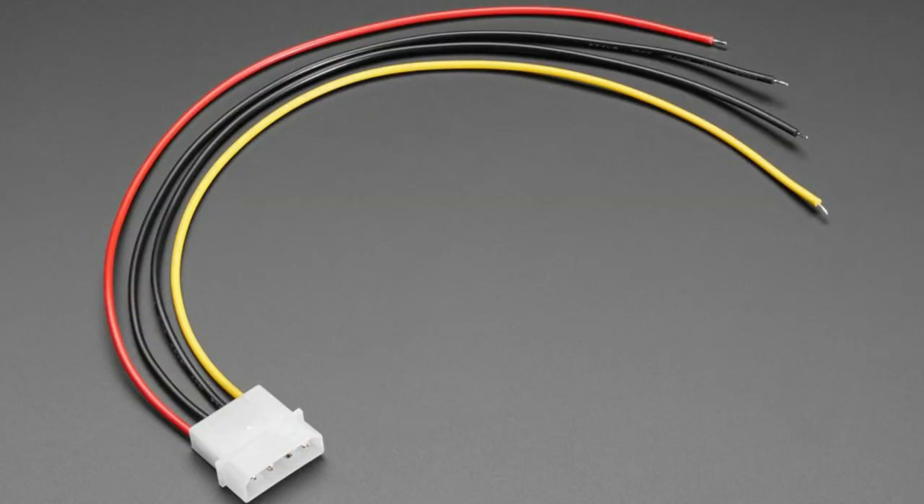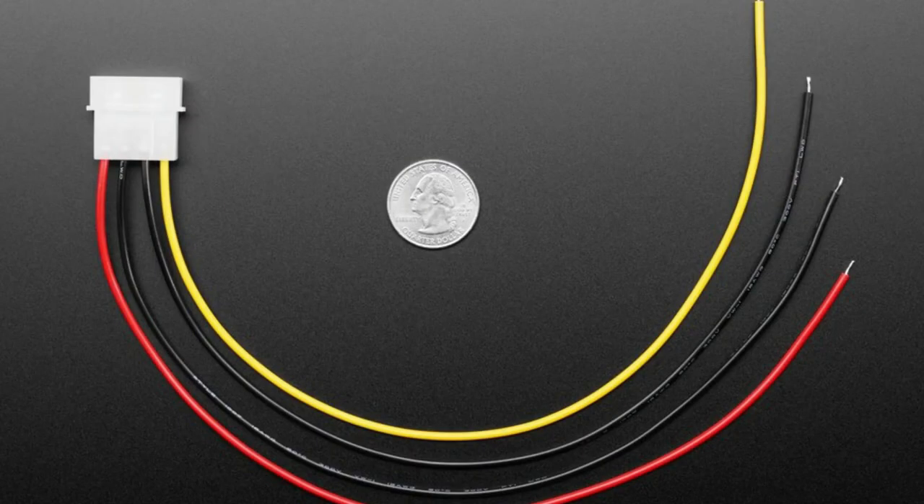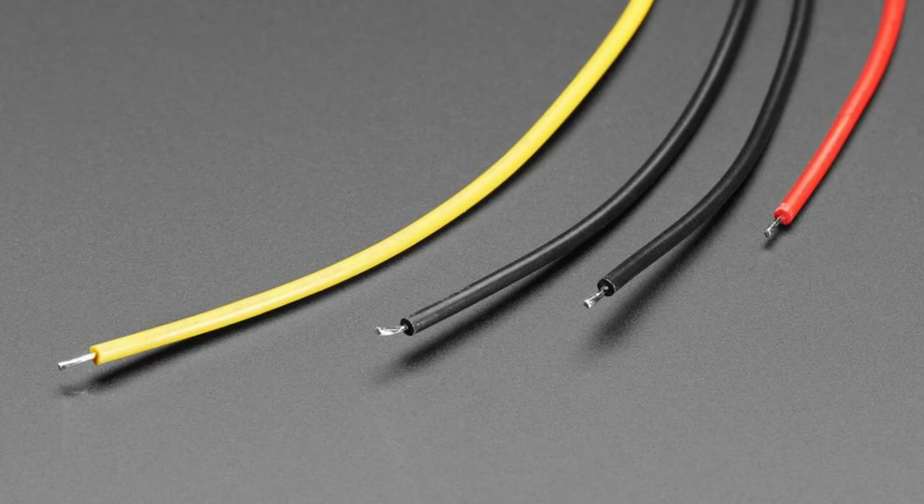Next up, another pigtail cable. This is a Molex — there's a part number, but it's just called a Molex IDE or floppy drive cable. We're using this because we're starting to do floppy things and we sometimes need 12 and 5 volt power. A lot of people have power supplies, or you can get a floppy or disk drive power supply — this will just break it out for you. You get two grounds, the red wire is 5 volts, and the yellow wire is 12 volts. Also really handy for making your own wire harnesses to connect to those high-power power supplies.